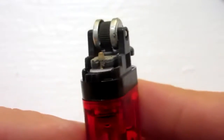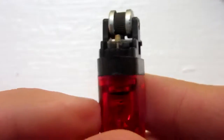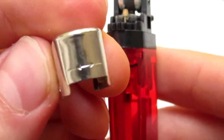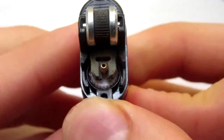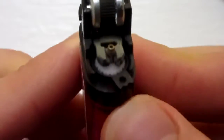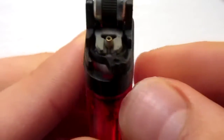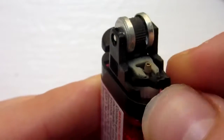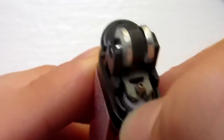And so now, to adjust the flame, this is the adjuster right here, and on the markings there on the metal thing, you can see positive is by turning this counterclockwise. So what we're going to do is turn it as far as you can counterclockwise, and then, as you can see here, it just engages those gears. So lift up the black ring to disengage off of the white gears, and push over to the left so we are not moving the white spindle.